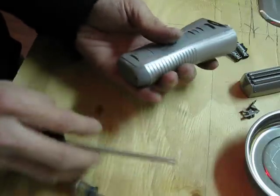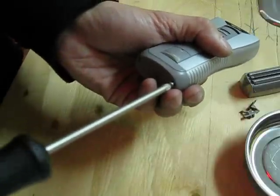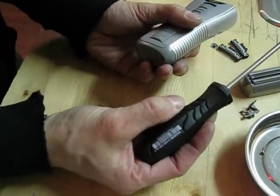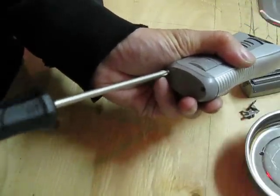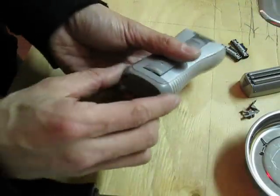Now we can take off the back side — basically just these two screws here. This is a Phillips-style screw, or actually it's not really a Phillips — it's actually a Japanese Industrial Standard screw. And I actually have here a Japanese screwdriver. Just looking at it by eye they look pretty much identical to Phillips, but they're actually not — the geometry is a little bit different.